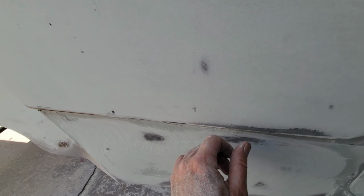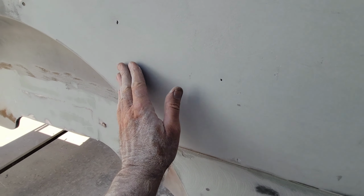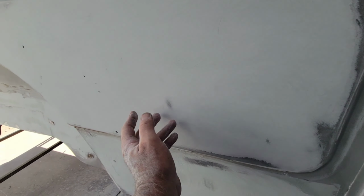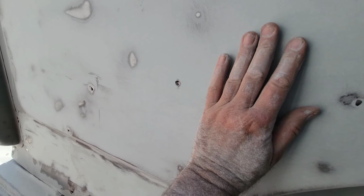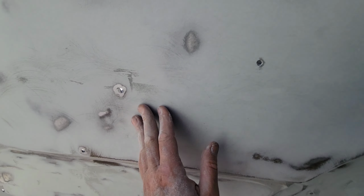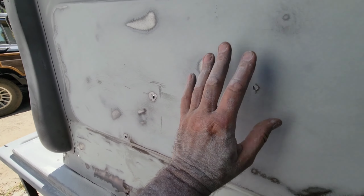All right, let's take a look at the guide coat, how that works on a Bondo, on a filler. See all the low spots now really easily. The thing that's nice about doing that with filler is you can do that over the filler, and then what happens is you use less primer to try and correct your mistakes. So this here, I just take base coat, just really light coat of base coat over it. You can see all this part's a low, so a nice thin coat of a glazing would be really handy. The USC Pro Glaze right now would go over that, but we're not going to get to that today.